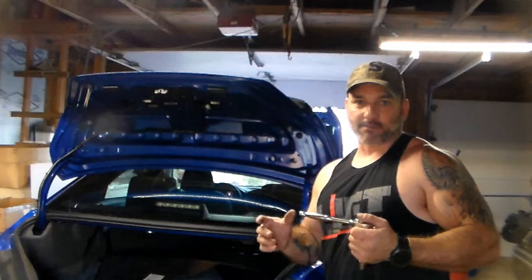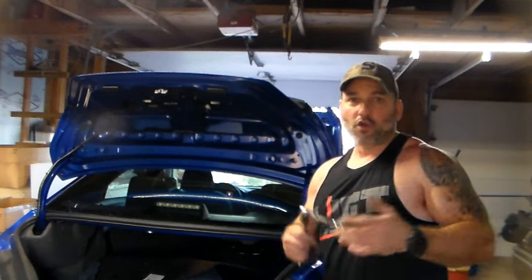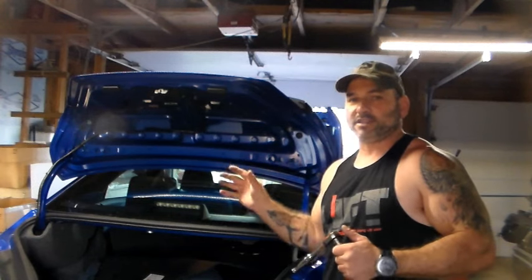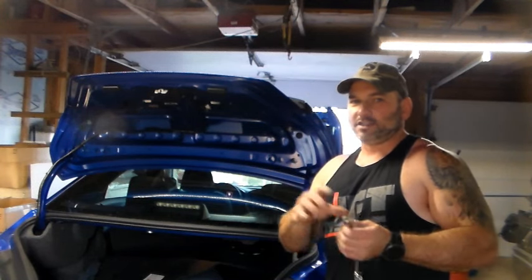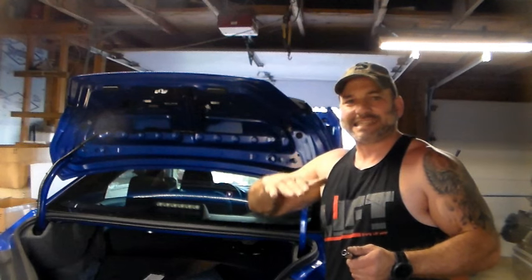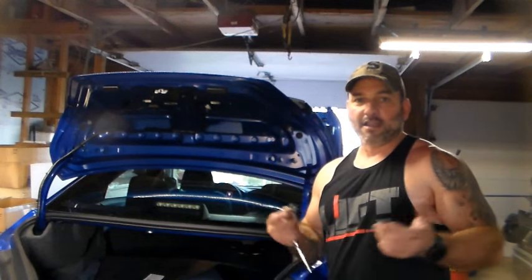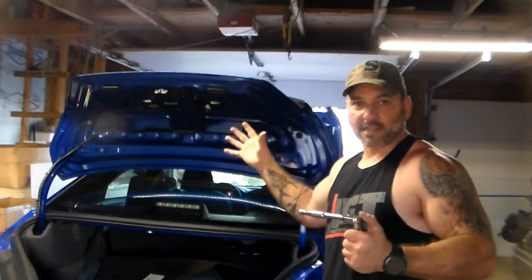I do wish they had given us torque specs. I tightened it until it was good and snug — when I move the spoiler I can see the trunk skin moving, so I know it's tight. But the weatherstripping is still visible, and their install video shows it being non-visible when pulled down all the way. I'm a little nervous about tightening more knowing the wing is plastic. But other than that, it's a fairly easy install. Now replace the liner, reuse all those clips, and we're done.